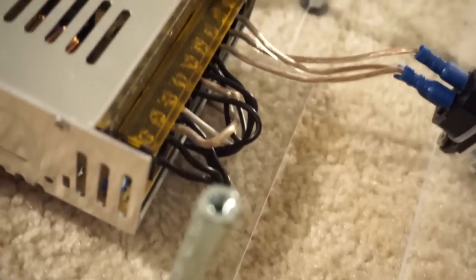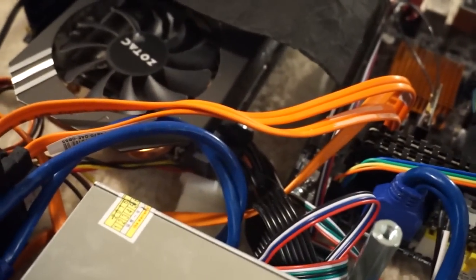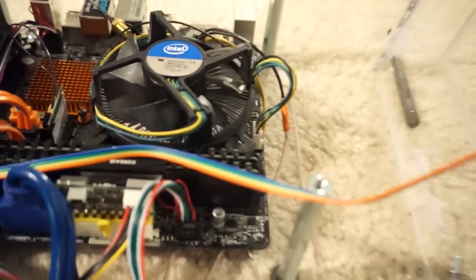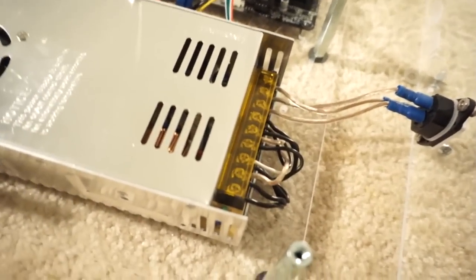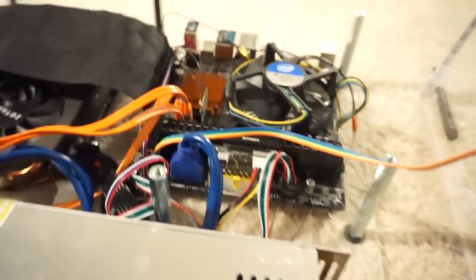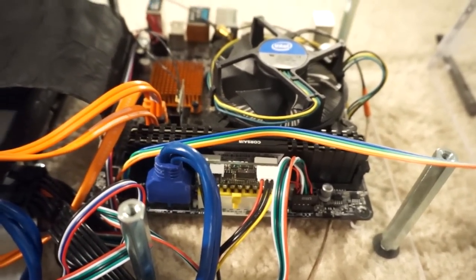It's definitely working out well for me where I just have an LED power supply and you can wire that straight into the bus right here, the PCIe power, and even directly into the processor power. All that can be wired to the 12 volts and it can remain on all the time and the computer barely uses any power at all until you power it on, and then the Pico PSU cuts on and then everything else is fine.